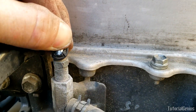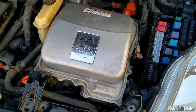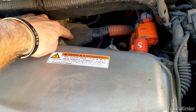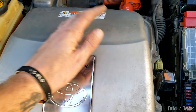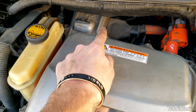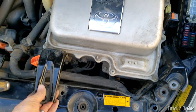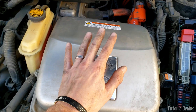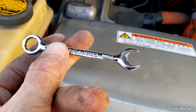With those disconnected, come around the front and undo this bleeder bracket — that's for the little bleeder valve. The bracket is right here, 10-millimeter, one bolt. Now we have a couple of big connectors going into the inverter, and to disconnect those we have to undo the bolts holding the top panel. There are lots of 10-millimeter bolts all the way around the lid and the back. For the back two I'm using a small box-end wrench to crack them, then finger power to get them off.